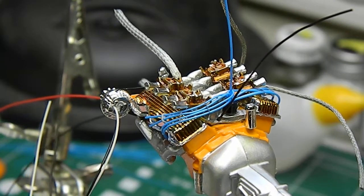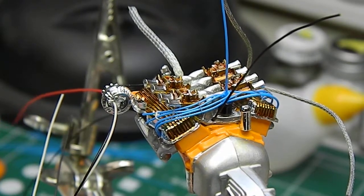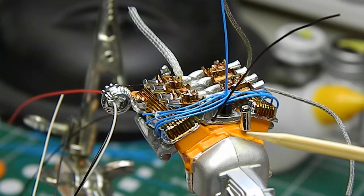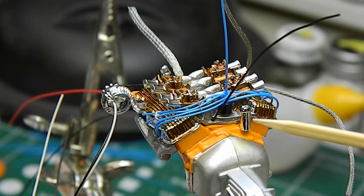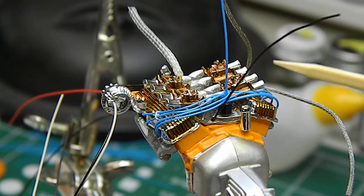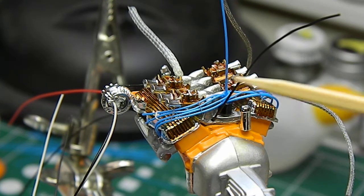not going to interfere with the firewall and what else is going on in the engine compartment, and we've mounted the ignition coil just on the back, between the intake manifold and the cylinder head. And once that dries, we just glued that a little while ago, we'll run the coil wire down to the ignition coil, and that'll finish off the distributor completely.